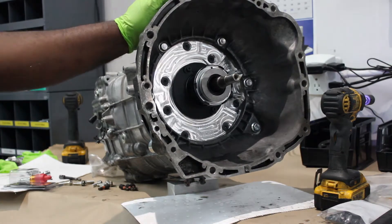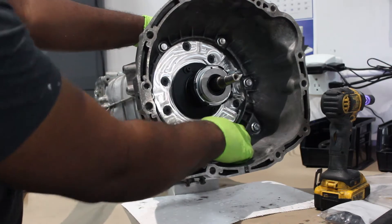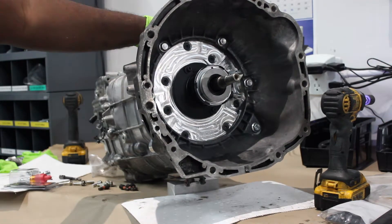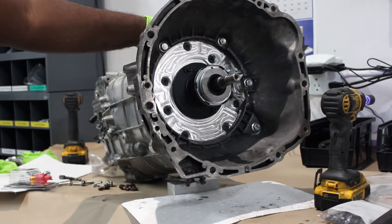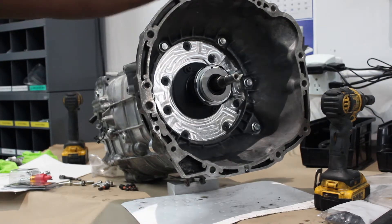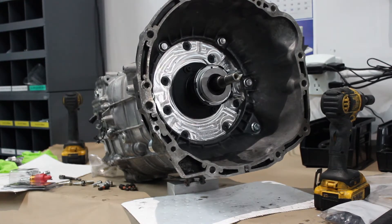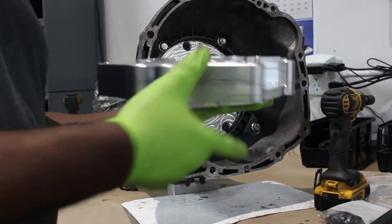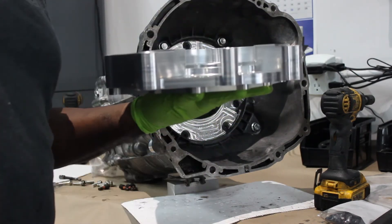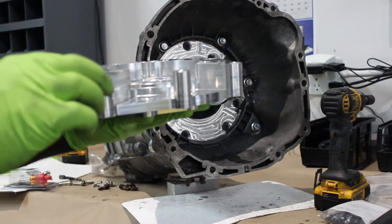And that's it — you're pretty much complete, ready to go. The torque specs for these are engraved on the bottom of the plate, obviously with the bell housing on it covers it. It's pretty simple and straightforward — it shows you how to install the seal, set up with the slave, and how to notch the J3 bell housing. The notching is only required on the J3. The J1 and J2 plate is going to be significantly thicker and has enough vertical height so you don't have to worry about notching anything. Notching is only applicable to the J3 bell housing.